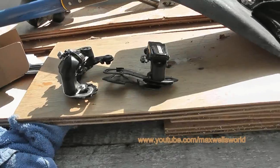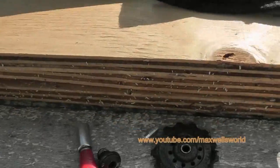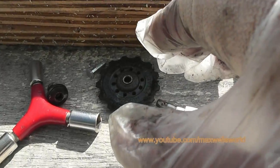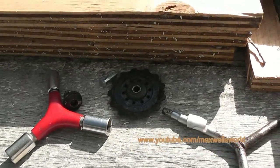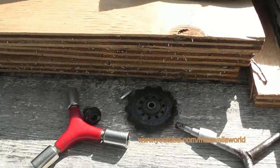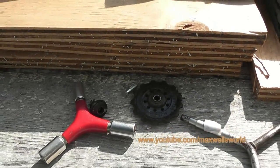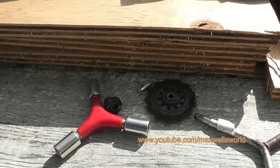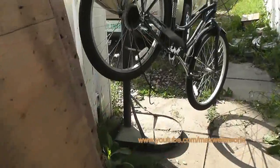The little pulley wheels are sometimes a smaller size on the replacement derailleur, which can throw the chain length out by about one link. That doesn't sound like much, but when you're dealing with small precision moving parts, one link can mean the difference between working or not. We'll drop the new derailleur in, give it a pre-adjust, and then start working on the handlebar.